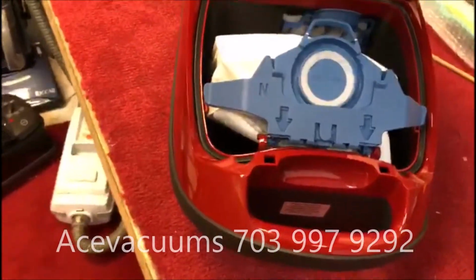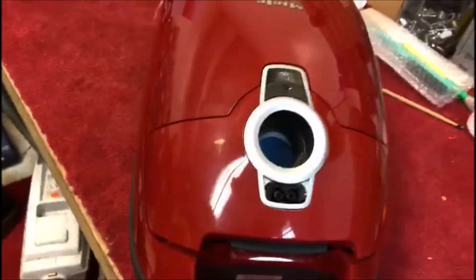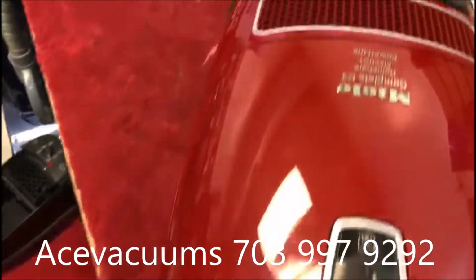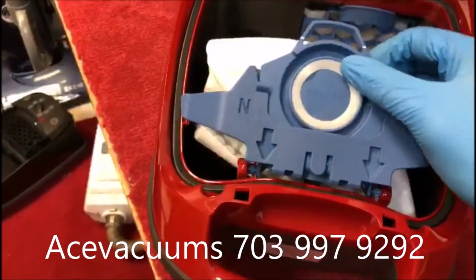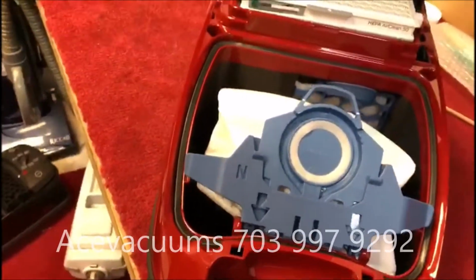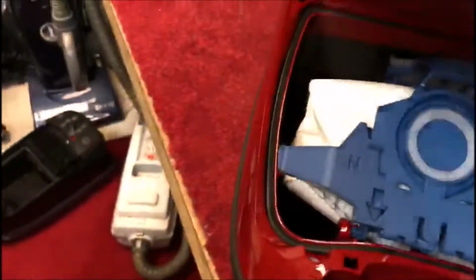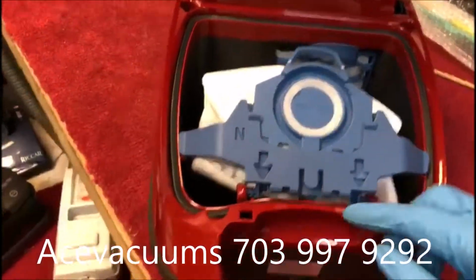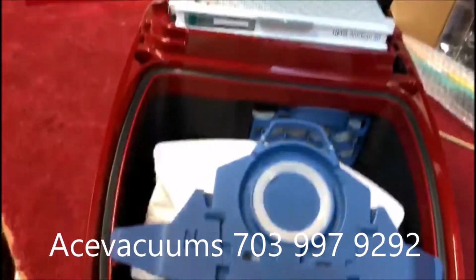Not really. What most videos won't tell you is that every time you open the dust compartment lid without changing the bag, especially on the complete C3 models, the bag is pulled back from its original secure position. If you close the lid without pushing the bag all the way in, there is a very high chance that the dirt you vacuum up is going to miss the bag entry and leak into the dust compartment. This happens because the port is not correctly aligned with the dirt entry.